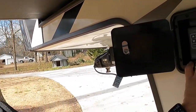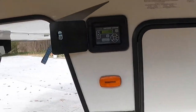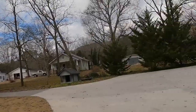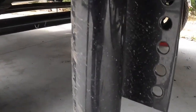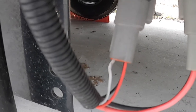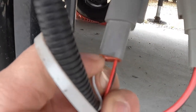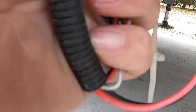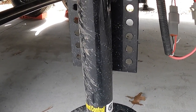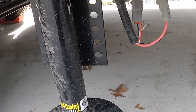To lower the middle jacks you press and hold left and right together. You can see that jack is coming down — that's the left middle. On the other side, the right middle jack still isn't moving, so that tells us it's the actual jack, not the control panel. Then I walked around and thought to check the harnesses and plugs — that's what everyone on YouTube says, that's what LIPPERT technical support said. And right here you can see that little white wire — it's bent. I thought, hey, that's bent like something pulled on it. When they zip tied it up at the factory, they bent it, and that wire came loose. That is our problem.